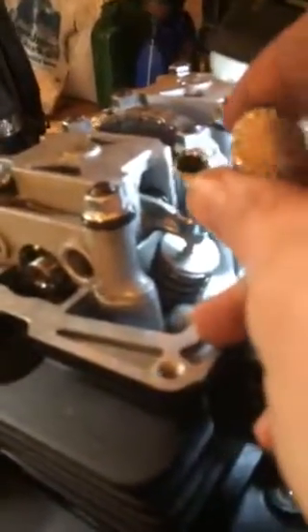All you're gonna need, obviously, is your tools to take everything apart on this side. You're gonna need a feeler gauge set to 0.15. I have a special tool — you can do it with a 9mm spanner, but this is an actual tool with adjusters in it. It just comes apart and clicks onto the nut.